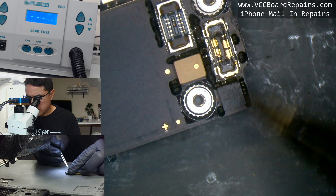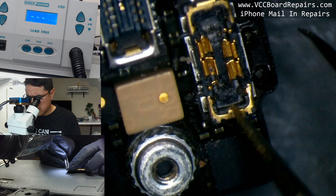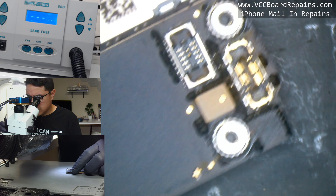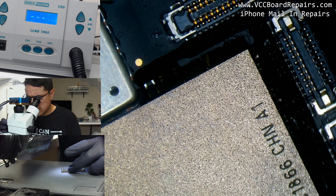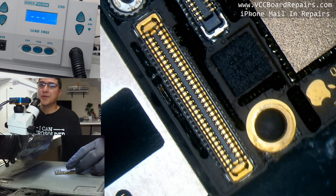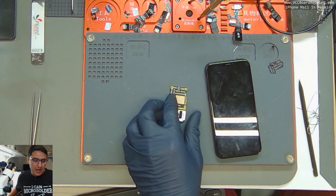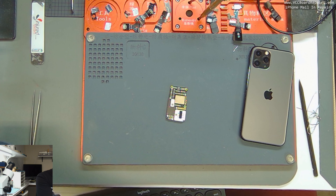I pick up the foam from the bottom under the adhesive so you can peel it off all in one piece. On the 11 Pro this connector looks a little weird — we'll check on that in a bit. I don't see any clear signs of water damage, and I don't see any clear signs of a shorted cap or any burnt-looking components. So next step is to connect to the DC power supply.